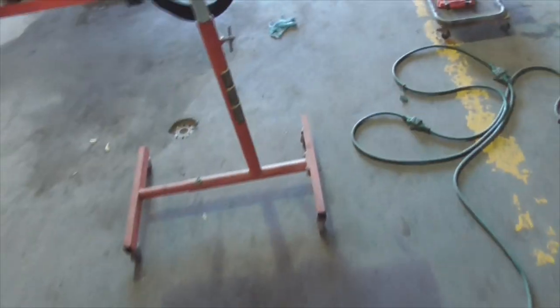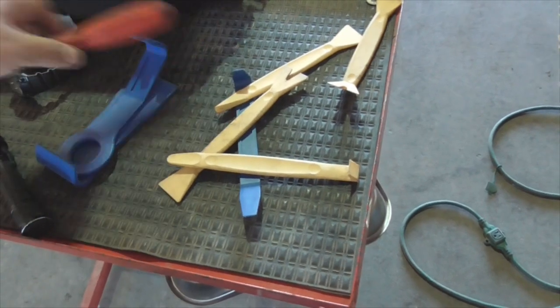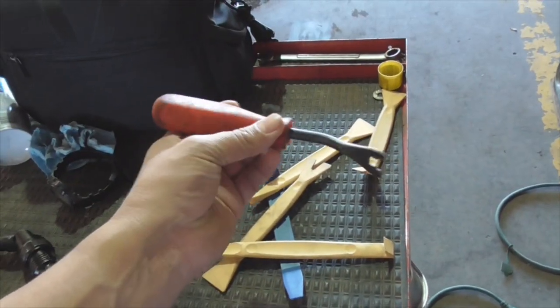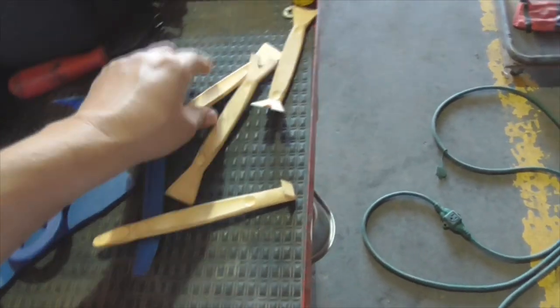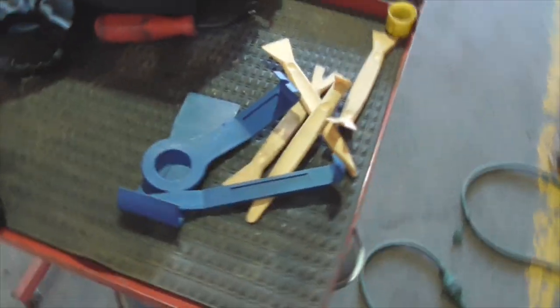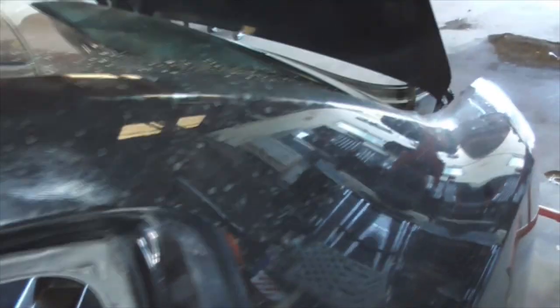You need to rock the seat forward — in this 2008 model you can rock it forward and it opens up to the trunk, and these little clips just snap right off. I highly recommend getting yourself a body panel and trim removal kit. A lot of us have those hard metal panel removers but the plastic kit will protect both the body trim panels and the paint.